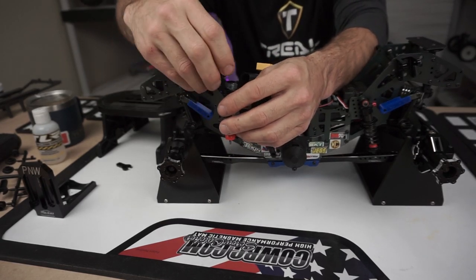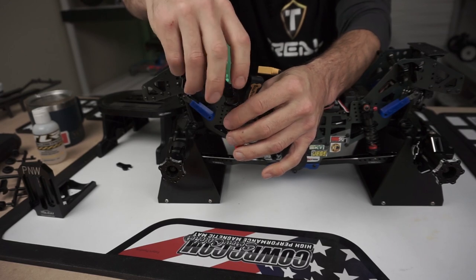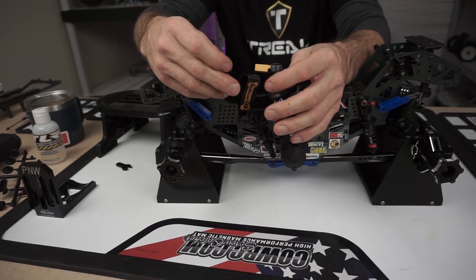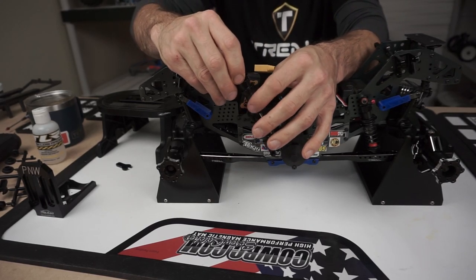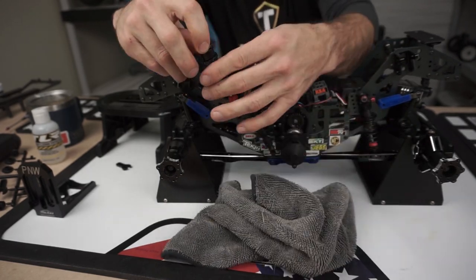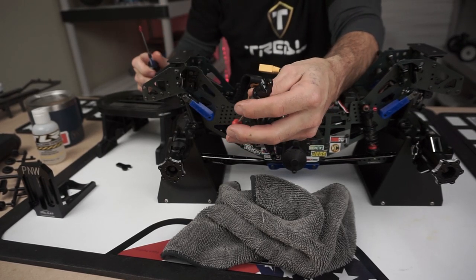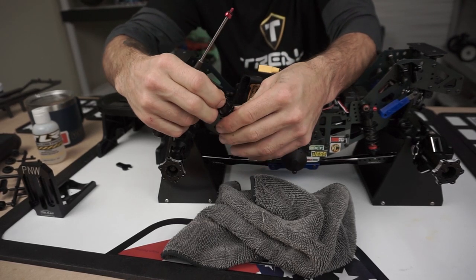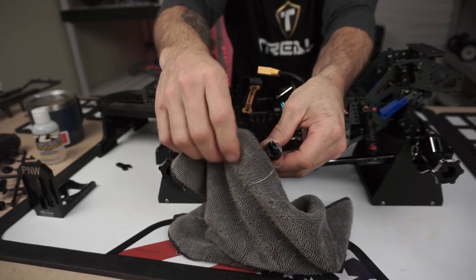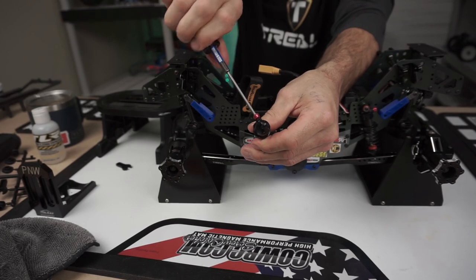The shock has sat for five minutes. We put some shock oil in the cap. What I like to do is hold the cap at a 45-degree angle, go ahead and snug that down, then put the air screw in there. Snug the cap down, rub off any excess with your rag, put the screw back in the cap, and you're good to go.